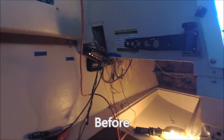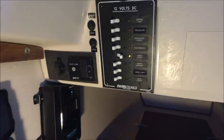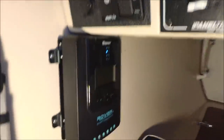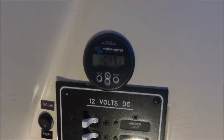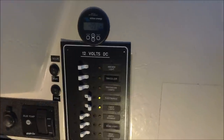There's a mess of wiring here that owners have added to over the years, so the best thing is to rip it all out and start over. The boat originally had a very small switch panel with inadequate wiring, so we've added circuits and put in a larger breaker panel. Here is a Raymarine plotter, an electric bilge pump switch with a 12-volt outlet, a solar charge controller with digital display, and a Victron battery monitor gauge showing voltage, amps from solar, draw from accessories, and cumulative state of charge.